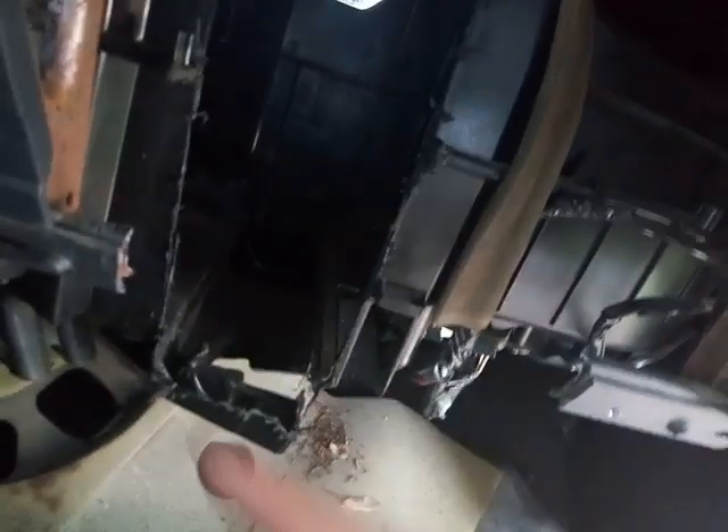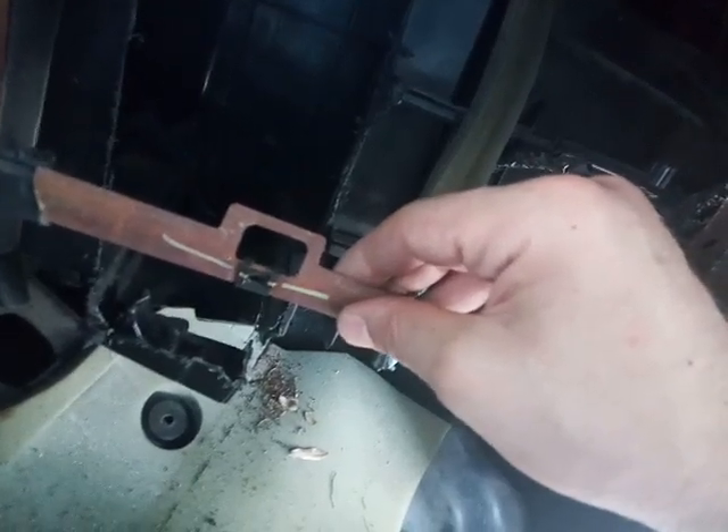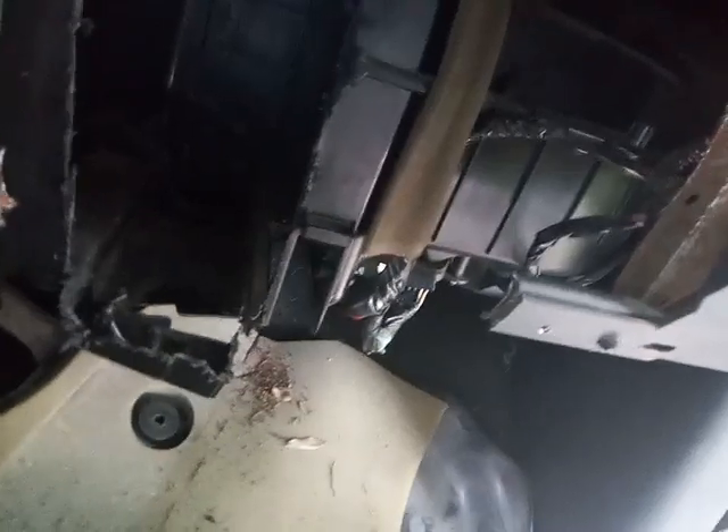And here's what you'll end up with. There's below the glove compartment right here. As you can see, this piece here used to attach right where you see the broken pieces. There's some rivets that you got to remove too. Fairly straightforward — there's three plastic pieces basically that you cut through, and eventually you just throw these away. There's columns here on the side that the glove compartment can reattach to easily, and it should support it just fine.